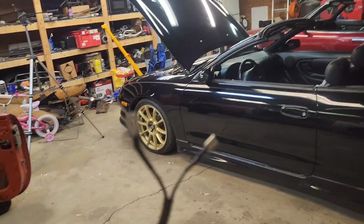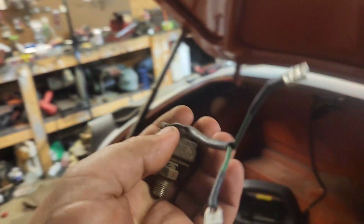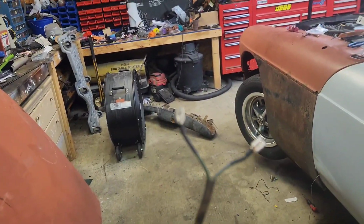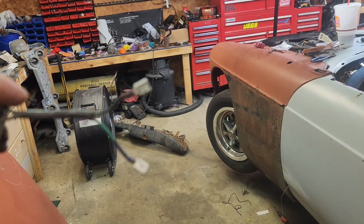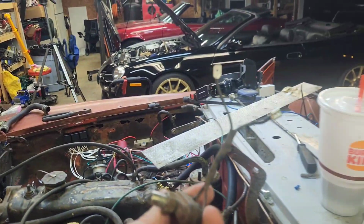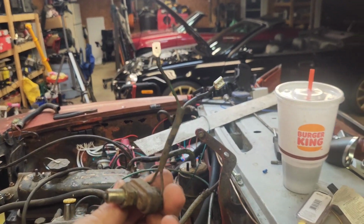So, next step was I went ahead and pulled the brake light switch out of the car, and I crimped new ends onto it, because that's gonna be easier to deal with than the bullet connectors that were on it. And with me putting a male on one end and female on the other, once I put the actual wiring together, there's a way to keep them differentiated from each other at all times. I don't think it really matters which way it's plugged in, but it makes me feel better knowing they're different.